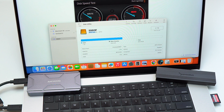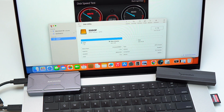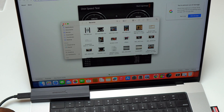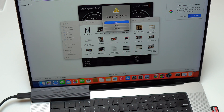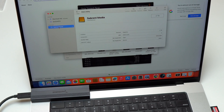In order to achieve the maximum speeds, you need to have your SSD formatted into APFS. APFS is the preferred format that will give you the maximum speed if you're using a MacBook Pro, MacBook Air, or any other macOS device. One thing to know about APFS is that it works only with macOS — if you plug this enclosure into a Windows PC or any other operating system, it will not be recognized. The first time I plugged in the enclosure, the MacBook Pro said the disk was not readable. To start using the SSD, you need to initialize it first by formatting it into your preferred format.